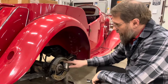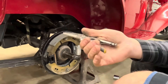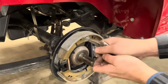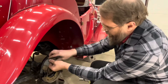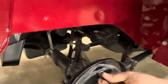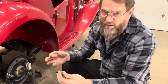Now we need to take the shoes off and get the brake hold-down springs off. The traditional brake hold-down spring tools don't usually work very well on these, but if you have a pair of needle-nose locking pliers you can get a hold of it right here with a small pair, then clamp it, push in, and turn and get it unhooked pretty easily. They can be a little fiddly - these go through here and you've got to get them in and turn them. It's all about just getting the line up and once you figure that out they come out pretty easily, but until you figure it out you can fiddle and get upset at it.